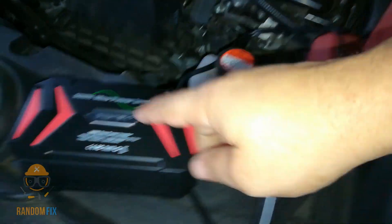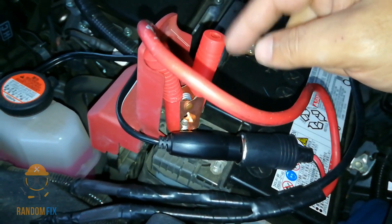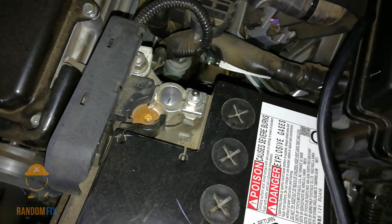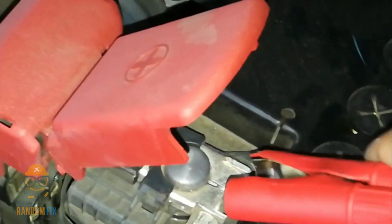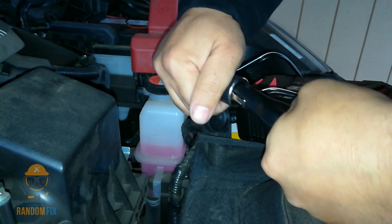You want to get your inverter hooked up — and don't go into the cigarette lighter port. I have mine hooked up here. Here's my positive cable and here's my negative cable. Try not to go directly to the negative terminal; you want it a little further away if possible. I'm hooking up a power inverter right to the front here on my 2016 Prius — the battery is located in the front. On older Prius models it might be in the trunk. Do not use your interior cigarette lighter for this purpose. If you're leaving this running in the garage, crack the garage door a little bit and make sure nobody's walking inside there — it might get a little dangerous.